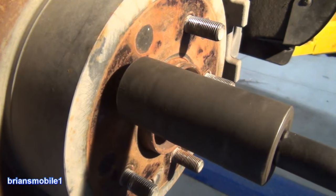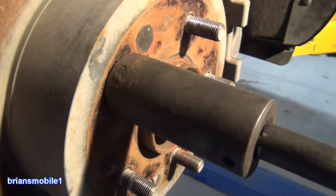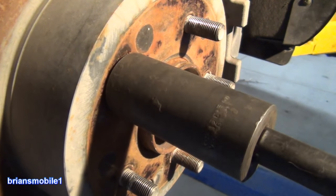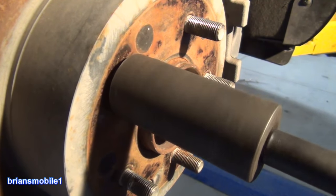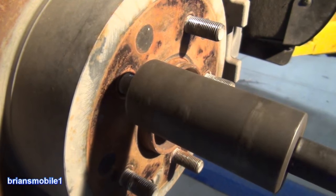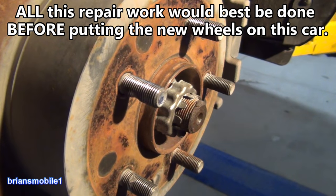I don't have a 25 millimeter socket handy and I don't really use my SAE kit, but this one inch came in real handy. That came from Harbor Freight — glad to have it, picked it up cheap. Oh, that feels so good. I love clean threads. I hate broken-off bolts and messed-up fasteners, because you never account for that labor time. If you have tools and tricks like this in your arsenal, you can blast through it in minutes instead of having to call in another order, get wheel studs, and tear everything down further. You can just do this and avoid all of that. Such a time and money saver.